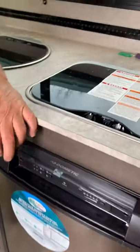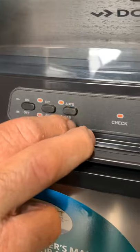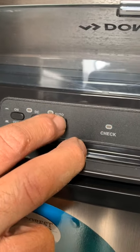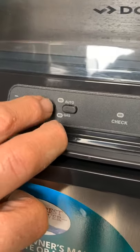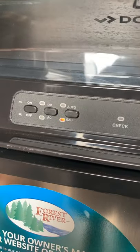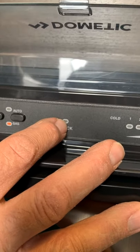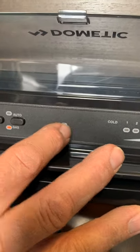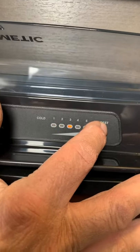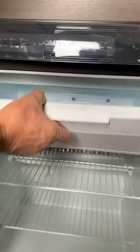Your refrigerator: start with, you turn it on. Then you check auto, or you can go to DC or gas. If you put it on auto, it goes from 110 to gas to 12 volts. If this little indicator light that's currently green — because it's running on gas — turns red, it is not operating; that means it faulted out and you probably need to turn the tanks on. This is the temperature selector; the higher the number, the colder the refrigerator will go. This is your travel lock so the door doesn't slide open — push that up and then the door will open. The freezer operates the same, with the same temperature regulator on both.